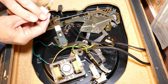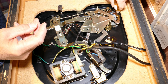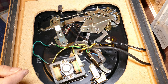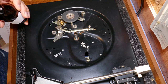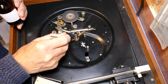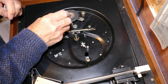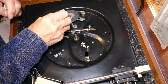For oiling certain parts, which is also called for by the service manual, you can use three-in-one, but for some of the more delicate looking parts I opted to use clock oil, which you can obtain quite easily online. This is a particularly light oil, penetrates well and is good for lubricating some of the finer parts on the Garrard deck. For the central spindle on which the platter sits I used a little bit of three-in-one, as it's a heavier duty bearing, but for the idler wheel bearing and for the top of the motor I used clock oil.